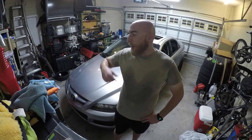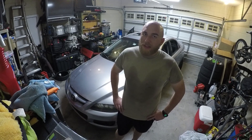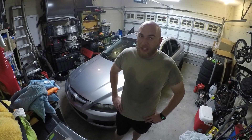So the gauge — I'll do a walk around and show where it's at. But this motor here, there's a lot of miles on it, it's 133,000 miles, and these cars don't tend to be playing too nice after the 100,000 mile mark. A lot of things tend to happen, they're very finicky. So I figured it's a good idea to wire up oil pressure and oil temperature gauge, because I'm going to be pushing this thing a lot on autocross courses, road race courses — really anything I can get myself comfortably into driving this car that I care a lot about. I feel like it's a good idea to keep an eye on these things.